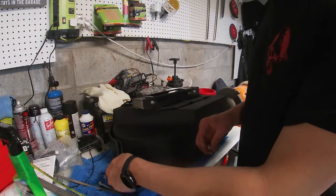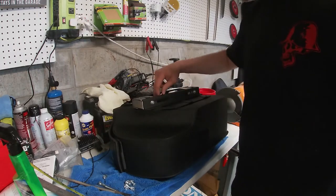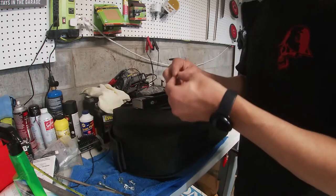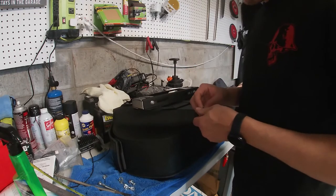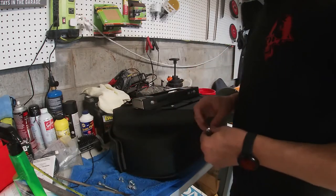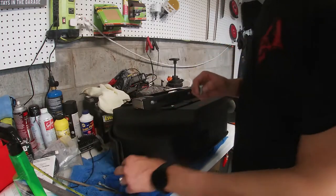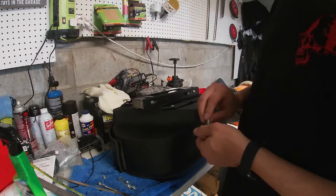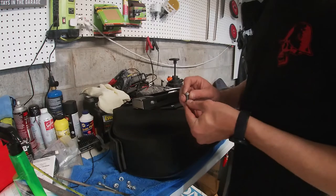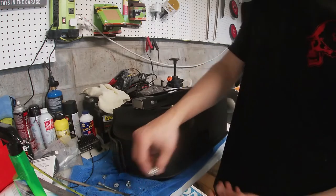Alright, we're back over here on the bench. Now I use washers on the inside here just because it's notched. It's going to be easy for it to push out with these rounded Phillips heads, but for these bottom ones you don't need to put anything on that. It's not going to go through there. Now you notice I'm not putting Loctite on it yet, and that's because on the other one, I realized as I put these things on, it removed all the Loctite, so I had to Loctite them inside the bag. You just have to be careful not to get Loctite on your stuff.